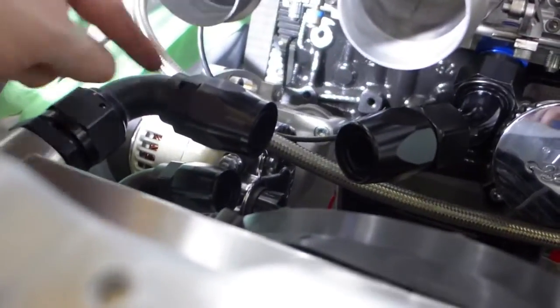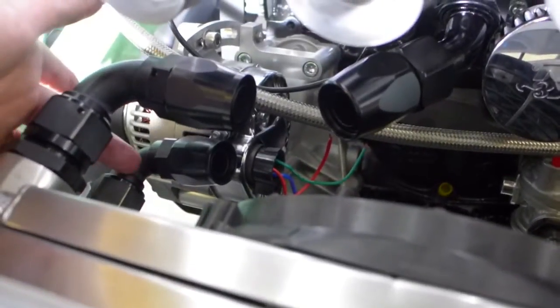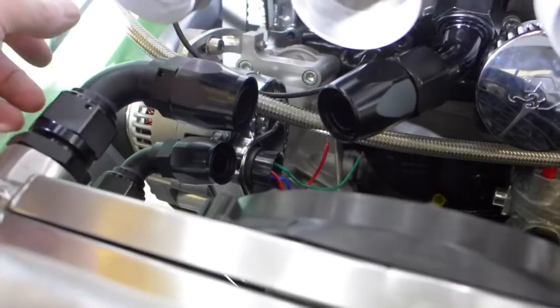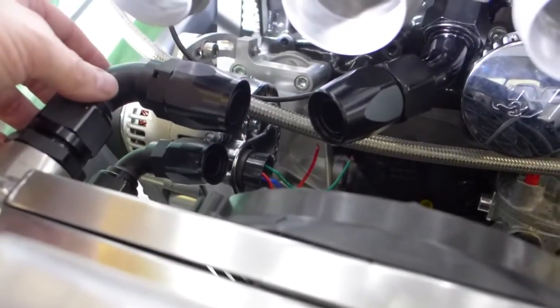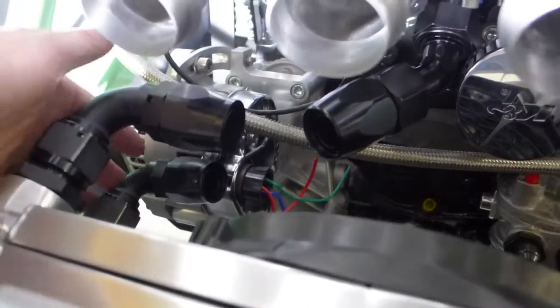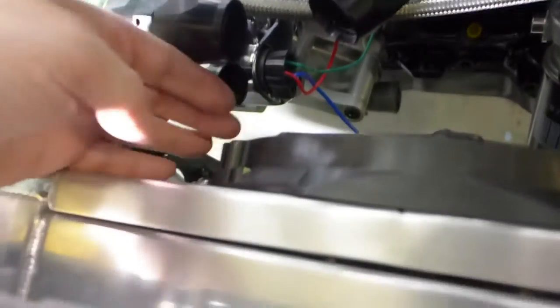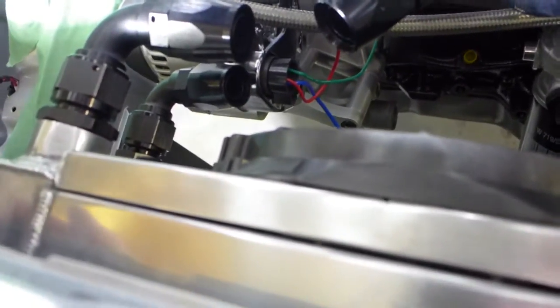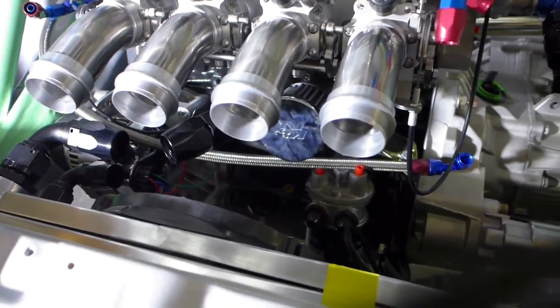And then here, grumble grumble, I'm going to replace these, both the 45 and the 90, on both the AN16 as well as down here in the AN12. I've got to go to the Earl's low profile fittings, so spend $180 to get new fittings, new hose, because the angles are wrong and they're too tight and everything else. So I'm going to move everything apart. I should get another couple of inches between these two connectors with the low profile fittings, and then rather than the 120 degree fitting there that I was using to clear the alternator, I'm going to have to go back to a 90, just because the 120 turns out points straight at the shroud. It's really tight. I knew I'd struggle with this area here, but we're slowly slaying the dragon on this thing, and throughout the weekend we'll make good progress.